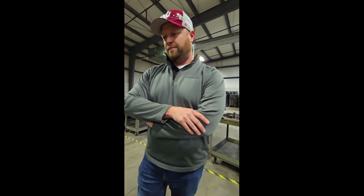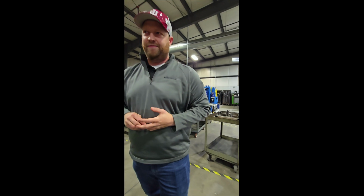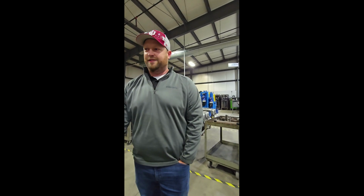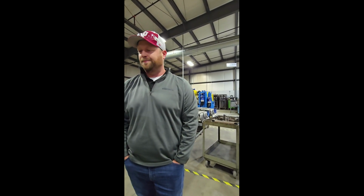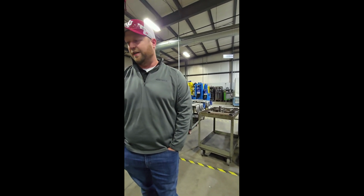Especially he's running 11-inch wide wheels. Yeah, but he's got fender flares. Well, it's just everything now. It's a lot more consistent. You know, the factory subframes are all over the place. So with some cars you might be able to get a max of 3 degrees, some may get 9. It depends on what day of the week that frame is built. Sure, that makes sense. And how they've lived over the years. You know, it's all 50-year-old metal. Yeah, tolerances are awful. You're lucky if you have two of the same control arms in there, or steering arms. Exactly.